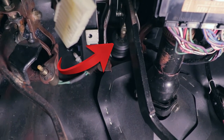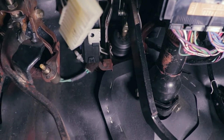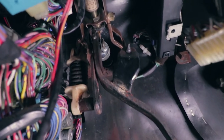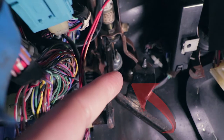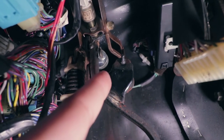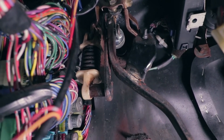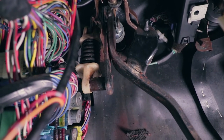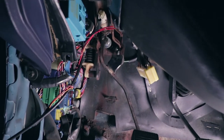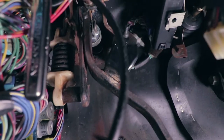And you would check around the seals for any signs of leak. You can also check the metal around it for signs of rusting. And there was not any on that. Now, if you look at the clutch master cylinder, which is a little bit harder to see, but back there, there's one of the nuts that hold it in. And there's where it sticks through the firewall. And you can see signs of leak from the seals as well as around it. There's a lot of rust around the metal on the firewall. So that definitely is the cause of our leak. Also, you can see that it's a lot easier to see everything with that cover off. We'll start off by removing the nuts.